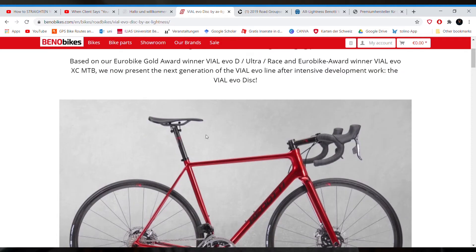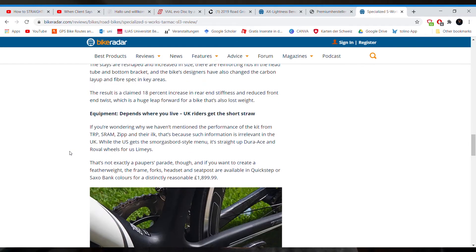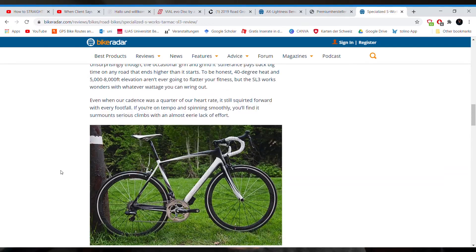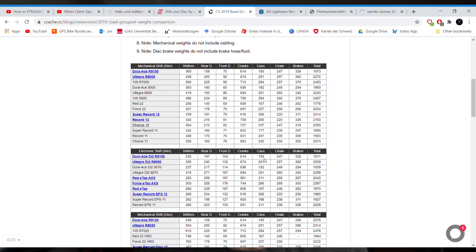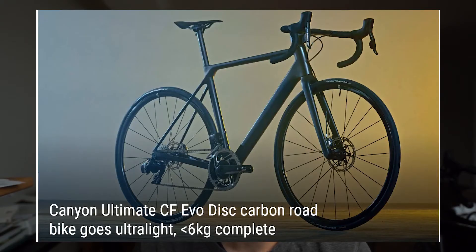With disc brake road bikes, the industry has to conquer a whole new challenge because they again have to bring down the weight. They've done it before — back in the day the S-Works Tarmac with SRAM Red would weigh in about 6.2 kilograms, and six and a half kilograms was normal. But the SRAM Red E-Tap hydraulic comes in at 2.2 kilograms versus SRAM Red 22 at about 1.77 kilograms — so the new groupset is about 450 grams heavier, which is a whole lot. So they have to bring the weight down again because of the heavier groupset, which is kind of ironic — with the disc brake standard on road bikes they sort of created that challenge themselves.